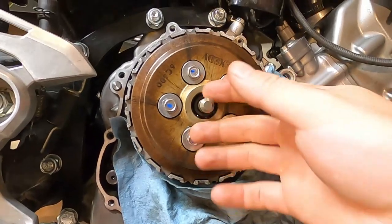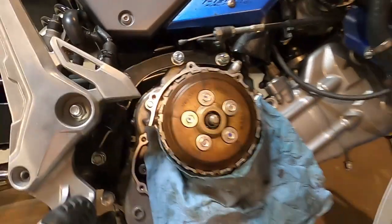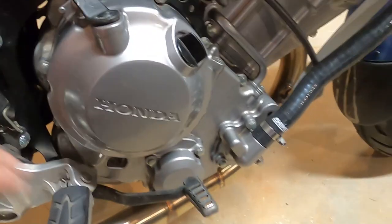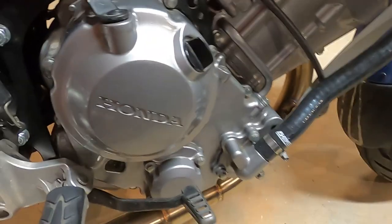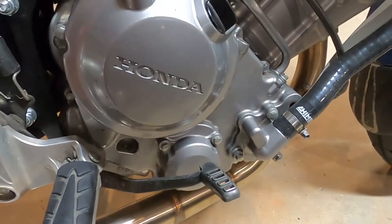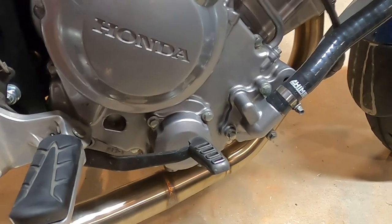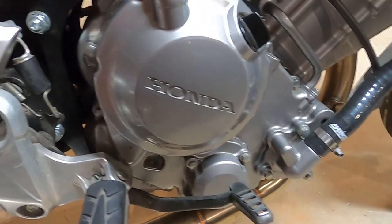This should be the right thing. Make sure we still got our slack. Okay, I'm gonna get a little bit of oil and put in here and put the cover back on. There it is. To tighten these case bolts, make sure you do them catty corner like you're supposed to and tighten everything the way you're supposed to, okay? There is one bolt that's just a little bit shorter, and I'm pretty sure that one goes in the drain hole there. It's only maybe an eighth of an inch, 16th of an inch shorter than the rest.